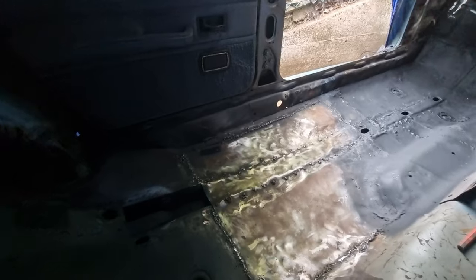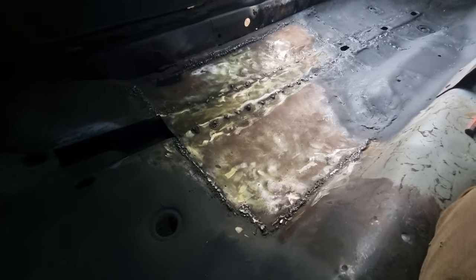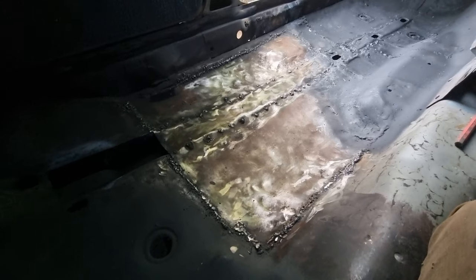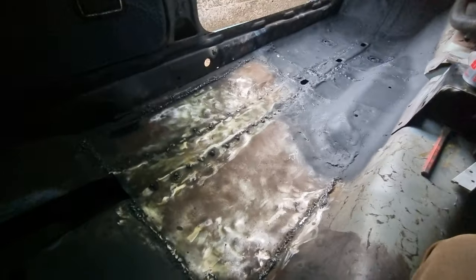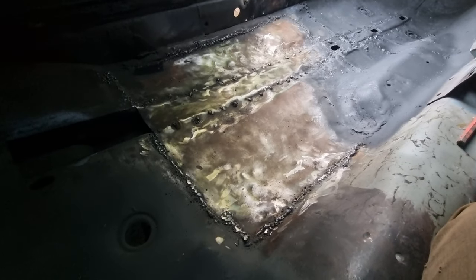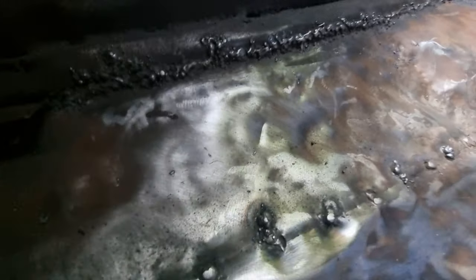In the next video you will see me finish that and then start the driver's side. When the driver's side is done and the car is completely solid, I'll then go around every little bit doing a few little touch-ups here and there - because nothing's going to be completely finished straight away, you've got to go around doing a few bits and bobs. The good thing about stone chip is you can spray it, get your grinder, and just grind the little bit off where you want to work. So if there's a spot weld I'm not happy with, I'll just grind over that little bit, re-weld it, and then re-seal it. There's still quite a few dents in this floor that I want to dolly out - basically I want to get them out.